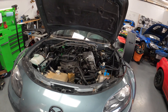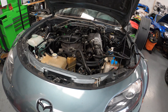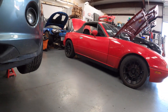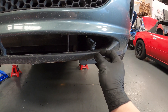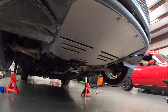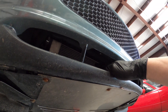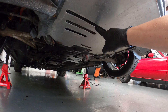Got all the bolts out of the supercharger. I still need to lift the car up so I can drain the coolant, so I can disconnect all those hoses and get that thing out of there — but physically it's not connected to anything otherwise. Popping under here, I've got a couple of notes. The ambient air temperature sensor is just hanging out. The customer also has this weird under tray that decreases cooling, because on the NC air has to go in and be forced up into the radiator — but in this case, air can leave out of the bottom, so it's not forced into the radiator at all.